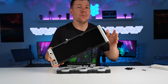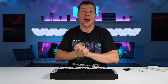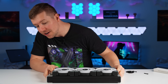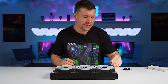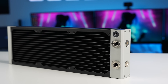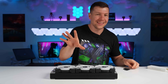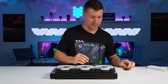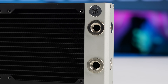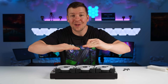While we are cooling both the CPU and GPU, we've gone with a P360 radiator, which is a lot thicker than the usual S360 radiators from EK Water Blocks, since we have both components in the loop. The CPU is only an i5 so it won't saturate the loop much — the heat will mainly come from the 7900 XTX GPU. The extra thickness should benefit us greatly, and I chose this one partly because the silver color on the top and bottom matches the ASRock 7900 XTX Aqua GPU and the power supply grill.